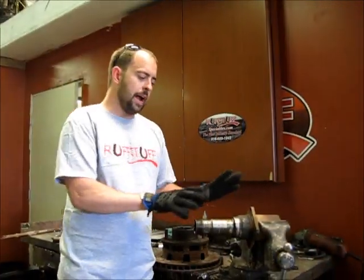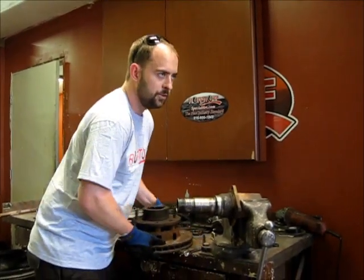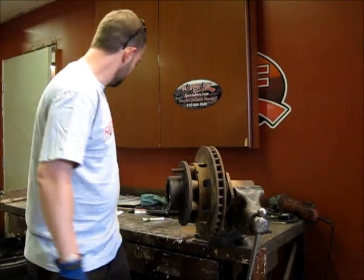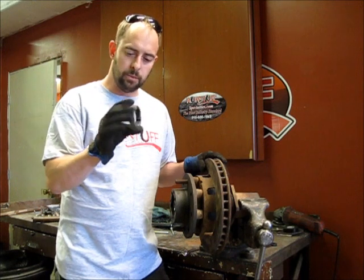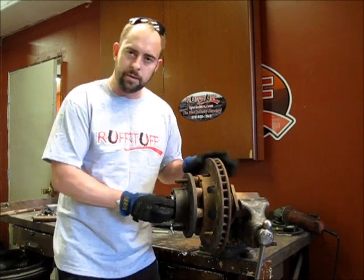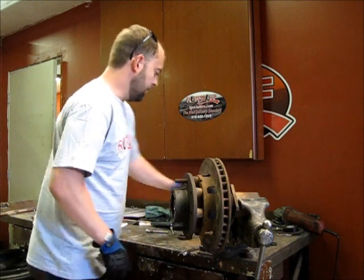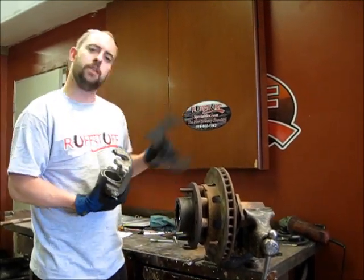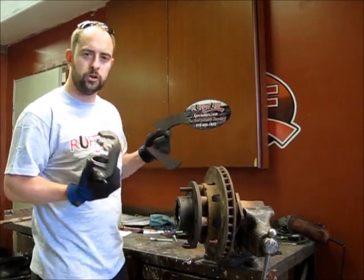This is what it's actually going to look like after you take your drum brake assembly off. You're going to put the rotor together, add this part, get it all put on there properly so it's all seated properly, and then you're going to assemble your caliper onto the brake bracket, which you can slide over the top.